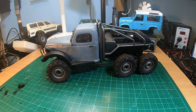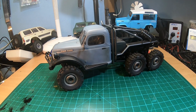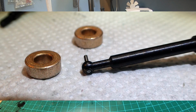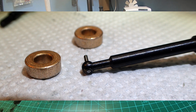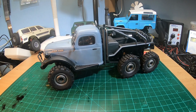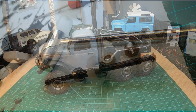So carefully hammer the pin and it will come out, and it doesn't have to get out totally. As you can see here in the picture, it's enough to push it fully inside on one side, and then you will be able to get the bushing out and the bearings in. I did it on 4 ends so far, CR24 and here, and getting those pins in was very easy too, the same way, no problem.